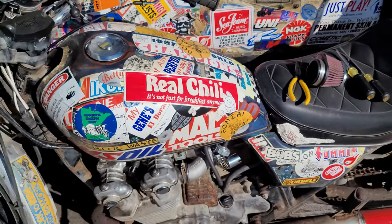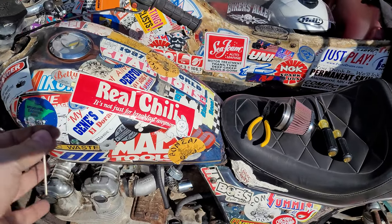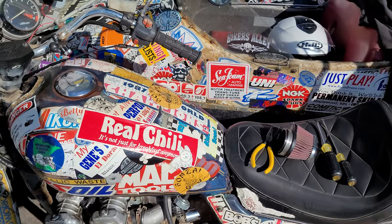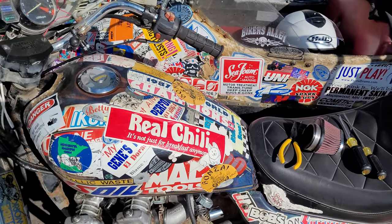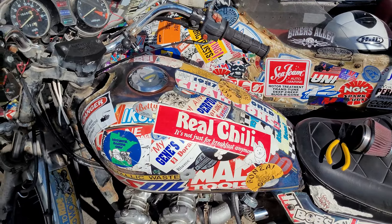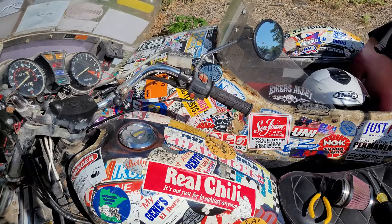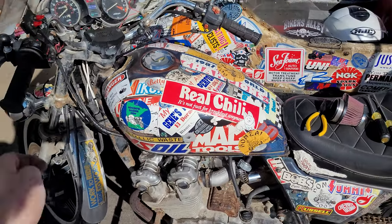See if that improves mid-range power, because what I was having to do going down the highway in this wind is downshift to fourth and go wide open, and if that didn't work, downshift to third and go wide open. And that's really hard on an engine with this much load and leaking oil.